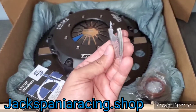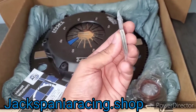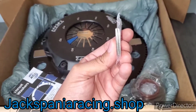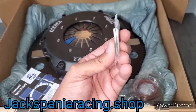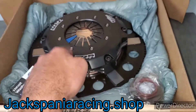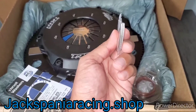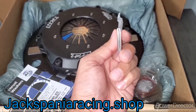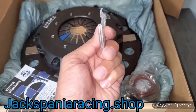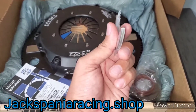Another thing worth mentioning — these are called thrust washers. They go installed on your crankshaft on your engine. If you're over-traveling the clutch pedal, you're pushing it more than it should go. All that pressure is connected to the crankshaft, so it has to go somewhere. It's going to make the thrust washers shift along with the crankshaft itself, because you keep pushing it further and further.